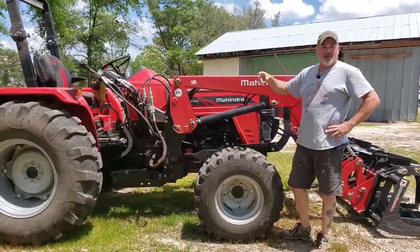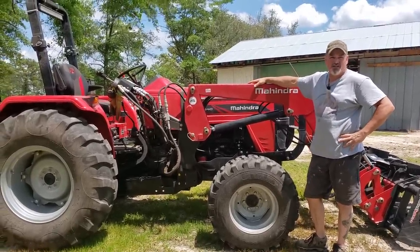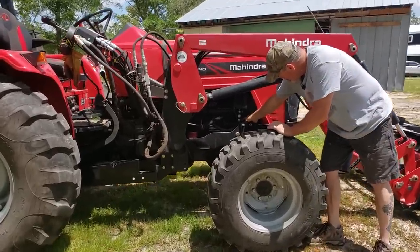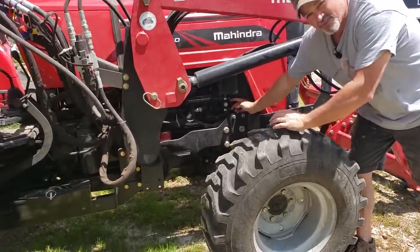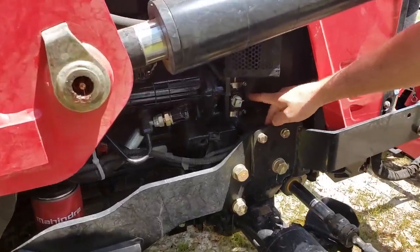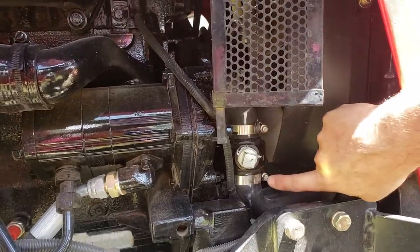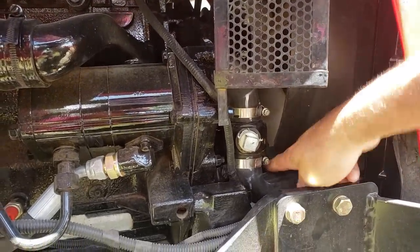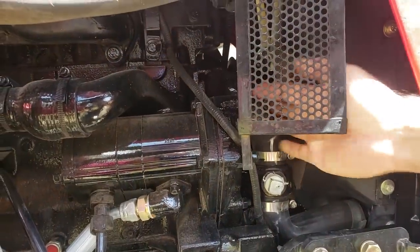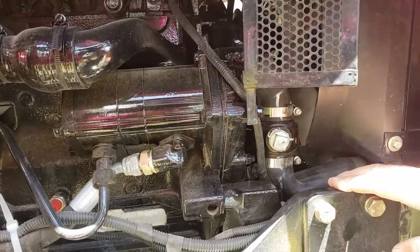With the coolant level checked off, we move on to step two. You simply check your connections for your radiator hoses. Look up here to make sure the hose clamps are tight and there's no leaking. Everything looks to be in order — it's not worn, everything seems in proper working order, and the four hose clamps on there are all secure. Everything looks great.